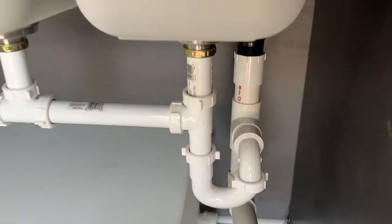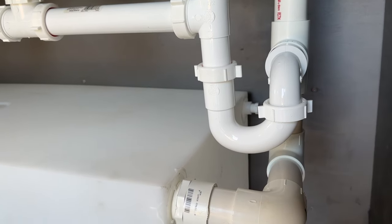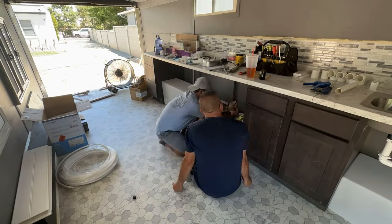Other considerations: weight distribution. Milk and water are about eight pounds per gallon, so be mindful about putting all your tanks on one side — especially on a single axle trailer where weight distribution becomes extremely important. For those doing horse trailers, I'm a big advocate of double axle trailers that haul 7,000 pounds. For vintage campers, you really need to be mindful of weight distribution and try to get your tanks on opposite sides towards the front. I prefer to have my gray tank closer to my sinks because PEX is cheaper and easier to run than PVC, and when drilling through cabinets, the hole is smaller.